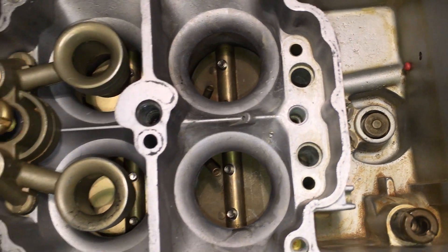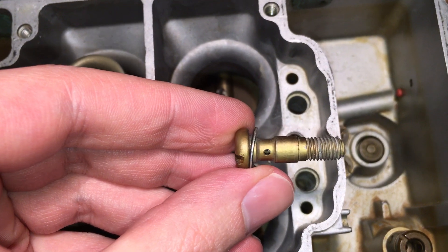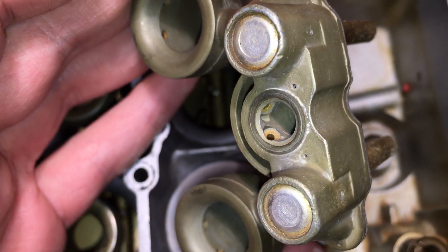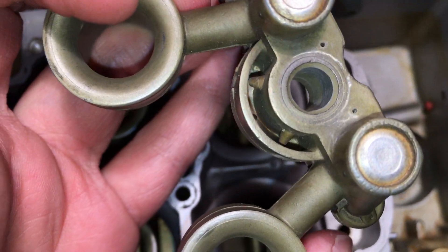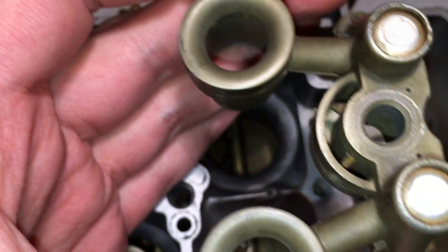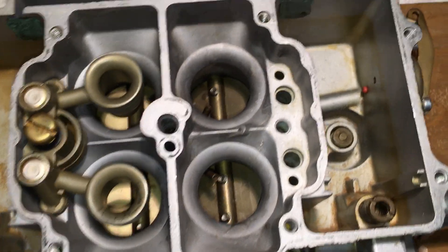The fuel actually comes up through there. The screw that holds in the booster venturi is hollow — there's a hole in it and holes on the sides, so the gas comes through that screw. Then it comes through the two accelerator pump nozzles in the booster venturi. You can see the two nozzles there — there's one hole and there's the other hole. Those come out, and you can see the two nozzles there. The fuel comes out those holes and squirts, hitting against the circular booster venturi part.